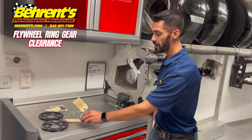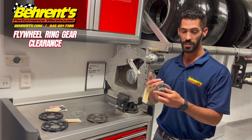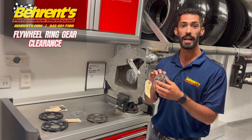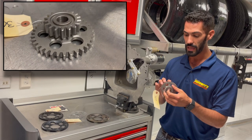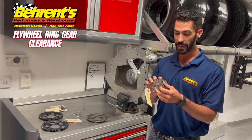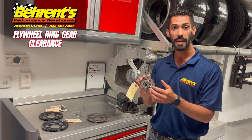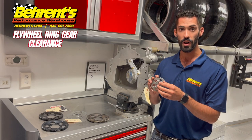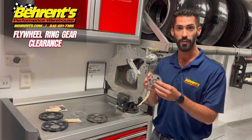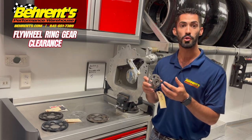Same thing goes for the idler gear that sits in the bell housing. So this bigger ring is going to be the part that's actually engaged to the starter. With it being too far away, you'll see wear on that gear. And same thing goes for the smaller gear, which is what actually engages into the ring gear on the back of the motor. Even though it's got rounded off edges, it's supposed to, so that when it comes to proper engagement, you have a smooth transition.